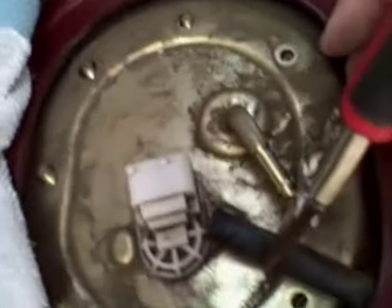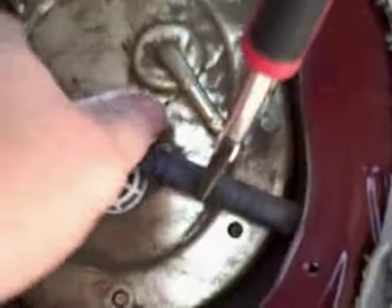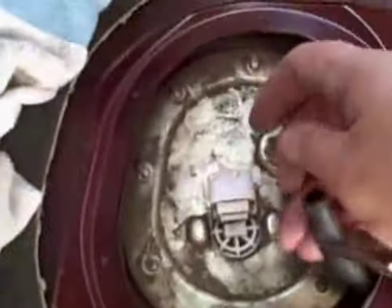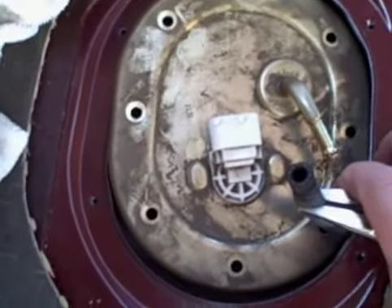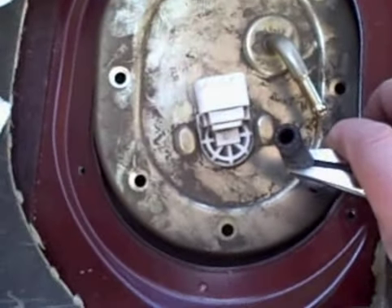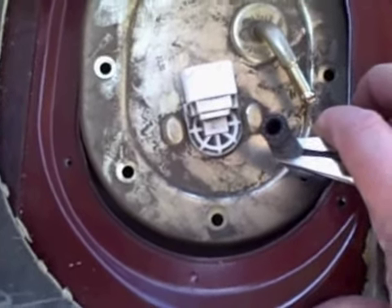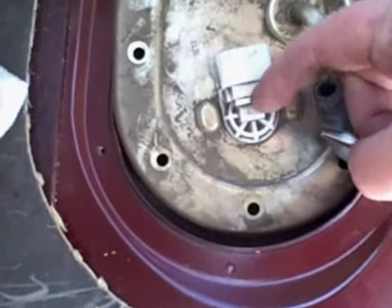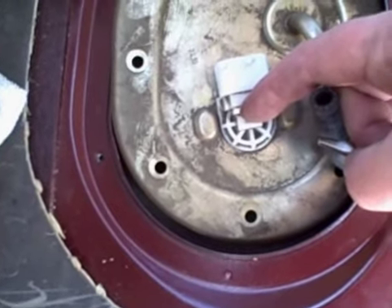Let me see what we get under this. I'm going to pick this whole thing up — I'm not going to have enough hands to do this. What we're going to find is underneath this panel. I've got to get this out of the way. I'm going to need both hands for this — I've got to keep this fuel line out of the way while I put up this panel. What's attached to, or clipped down underneath the underside of this panel, is the electrical connection at the bottom here, where the wire for the fuel pump runs into.